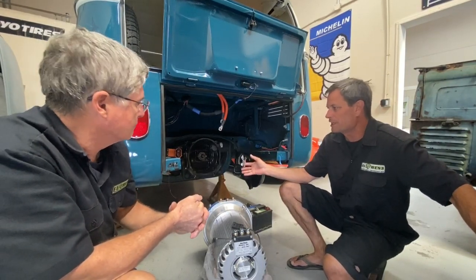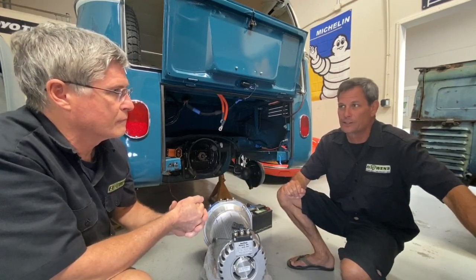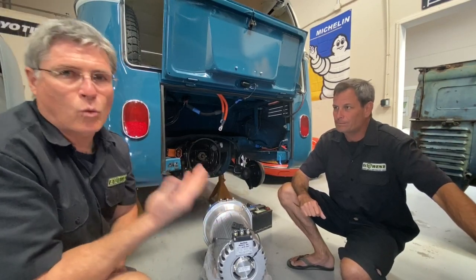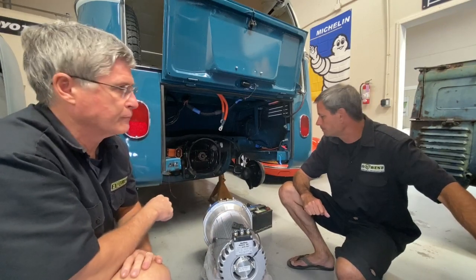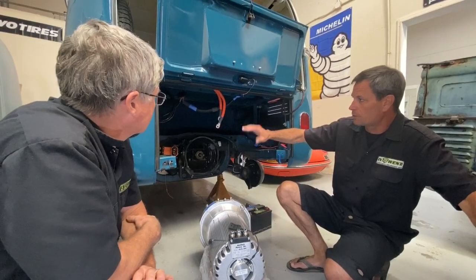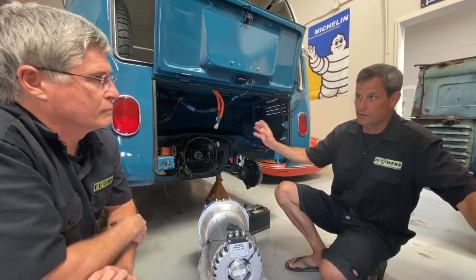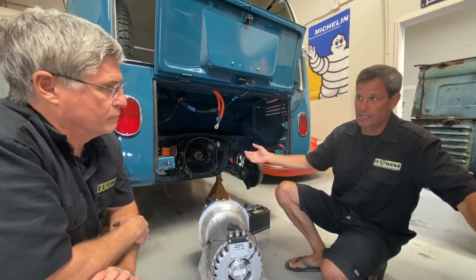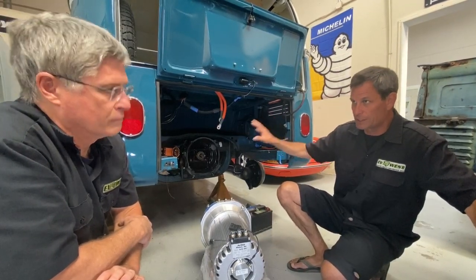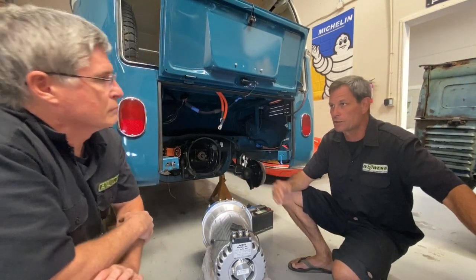This one's running about 110 volts, which is pretty much the standard voltage for one of those 1500-watt heaters. It's like having a house heater in your bus — you never have to wait for the engine to warm up before you get heat. You get heat immediately. We've also got a big battery box in here, and part of the build is keeping the battery enclosure within the motor bay so that we don't have any heavy cabling leaving this area. Essentially 98% of the conversion is in this bay. The only things leaving here are the throttle pedal and some instrumentation.